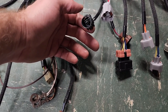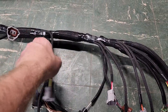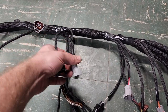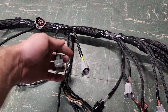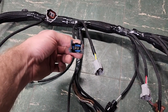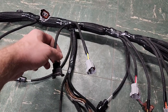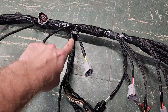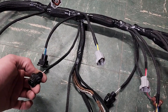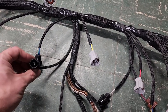The next bundle has two connectors on top: the number four injector and the cold start injector. The cold start injector uses the EV1 style and that never changed through all the years. Coming down, we've got the rear knock sensor — it's back just in front of the starter, a pain to get to but accessible.